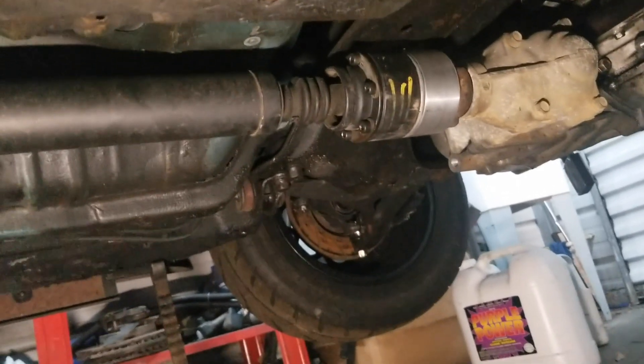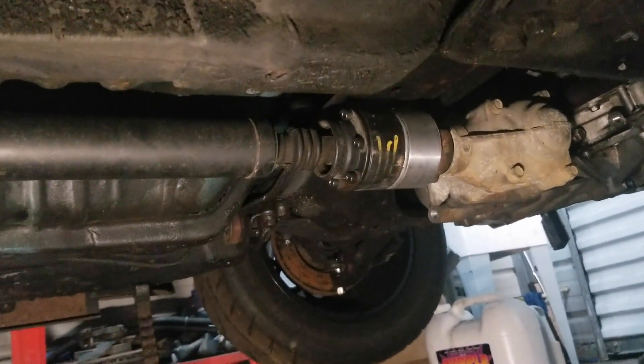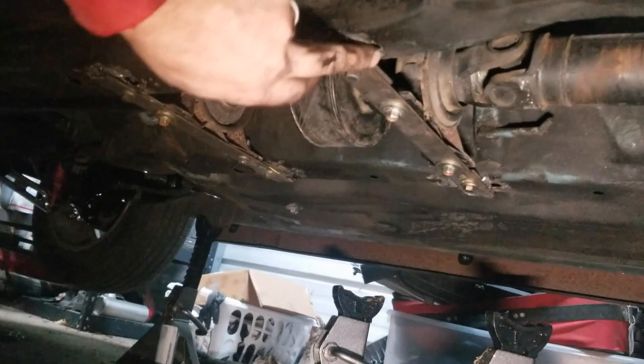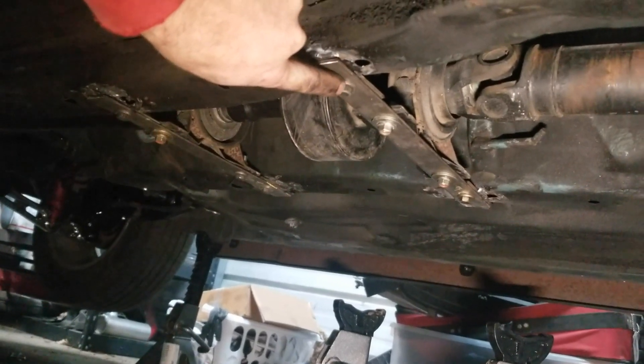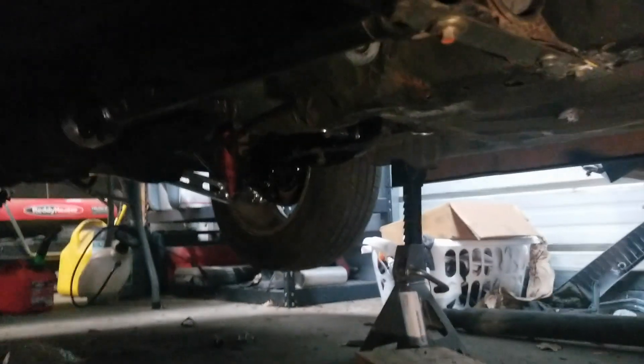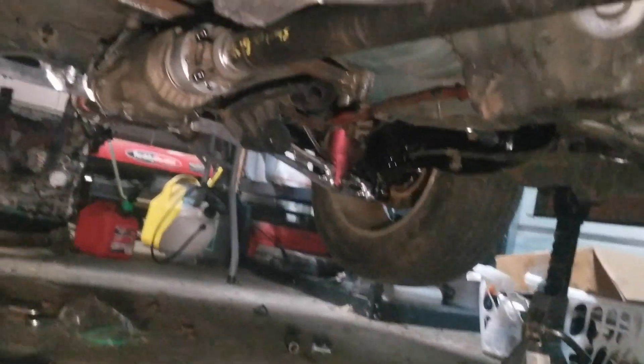The other half of the drive shaft is still laid up under there under the Civic, so I'm going to get under there and see if we can get something going. I just got the drive shaft installed — it's not the final mount, I'm sure I'll take it back out whenever I pull the transmission to put my built gear set in. You can see the billet adapter over to the Freelander drive shaft. I've got some mounts made up here — I've welded some tabs onto the body. This bolt holds the bracket up to the body, and these bolts hold the actual carrier bearings. If you let this bolt and the bolt on the end out, you can drop this whole assembly down. Same with the back of the viscous coupler here — it's got two straps, and you can see the Freelander viscous coupler doesn't really hang down.